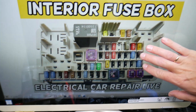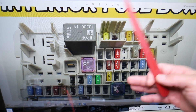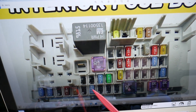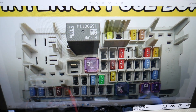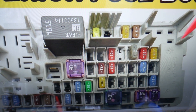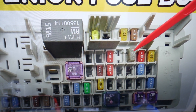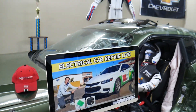So here's where the steering wheel switches fuse is located — let's zoom in. Quick tip: never assume fuse numbers, because whoever numbers them uses some unusual logic. For instance, this box goes fuse one through nine and then jumps to 38, 39, 40, 41, 42 — a complete mess. You'll need to come to that row of fuses and check fuses 29, 30, and 31. That two-amp fuse right there is the one you need to check. Hopefully this video is helpful — thank you for watching, see you next time.